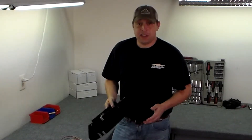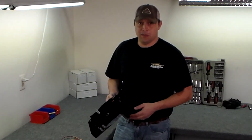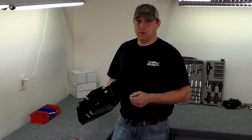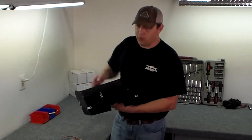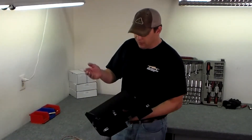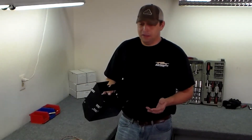Let's take a look at what we're going to be doing with our Nova — maybe that will give you some ideas for your installation. Our false glove box, because of its size, is going to give us the opportunity to mount some of our other components, including our fuses and relays. The fuses are going to mount on the front of the panel and be accessible through the front of the glove box — very easy to replace a blown fuse. As far as the relays, we're going to use the back ledge we've created on the false box as a location for them. We can probably fit a dozen or so relays there, even though we'll probably only need about three or four when this installation is done. This false glove box has just become a bit of a slam dunk.